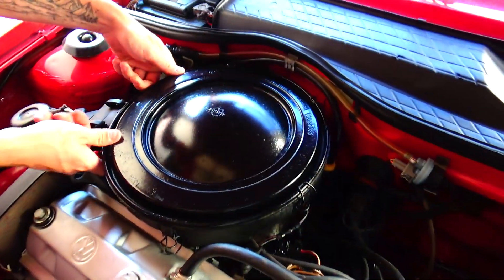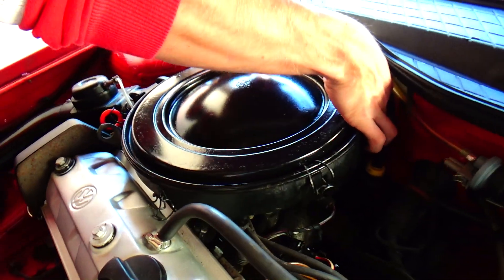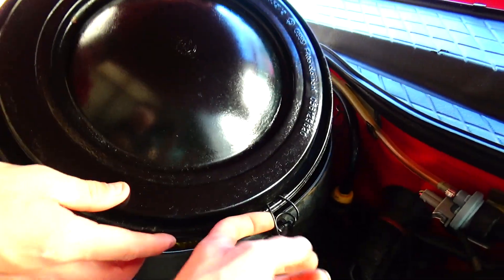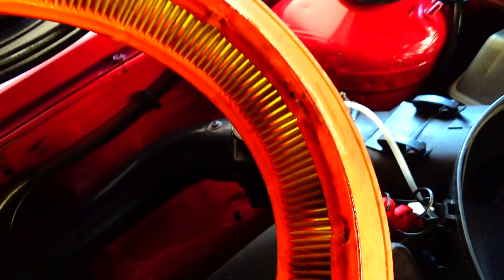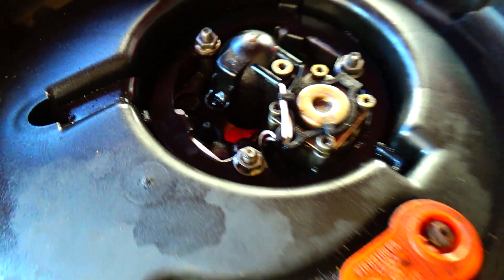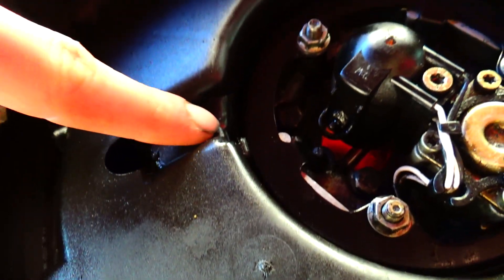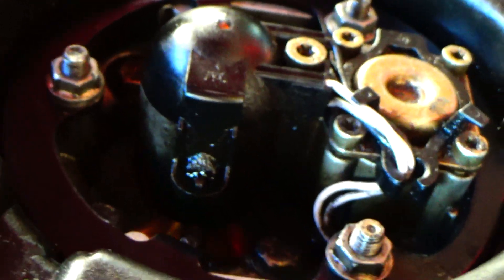To start with, we're going to take the air box off so we can get to the carb unit. That's Tommy — look, this was actually quite oily. Yeah, it's quite oily in there. You can see it all on the bottom of the air filter. It looks like the breather's kicking it up. It's coming from there — that is the breather. Kicking up a lot.